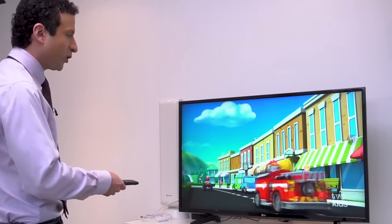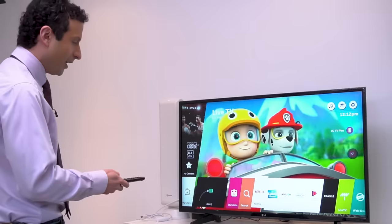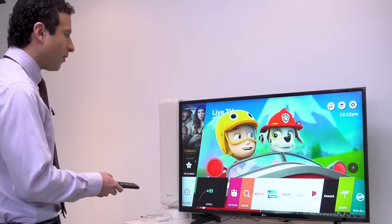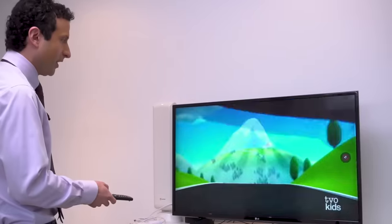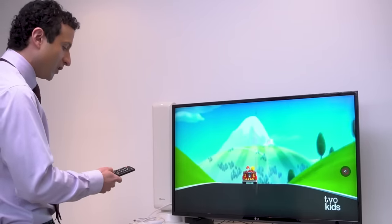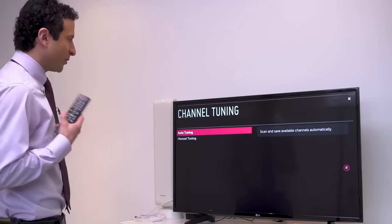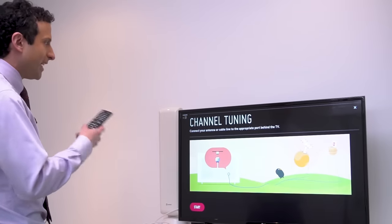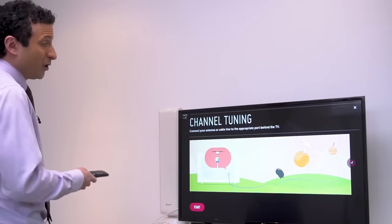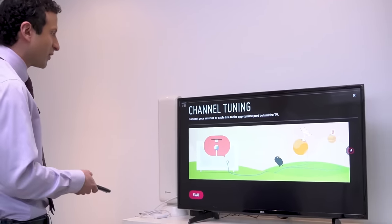I'm gonna show you now how to get the free channels added to your TV from the antenna. We've already searched through the channels, but I want to show you that on this smart TV I already have Netflix, Amazon Prime, and access to YouTube or Google. But if you're not a Sling TV subscriber or enjoying live TV through DirecTV Now, and you just wanna see what an antenna can give you, this is what you need to do. On any regular television, go into your menu settings and do a channel search. You can auto-tune or manual scan — auto-tune is the easiest. The TV runs through all available channels and programs them into your television guide, so all you have to do is change channels just as you would with satellite or cable.